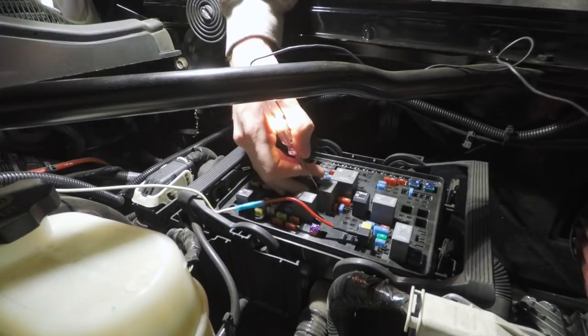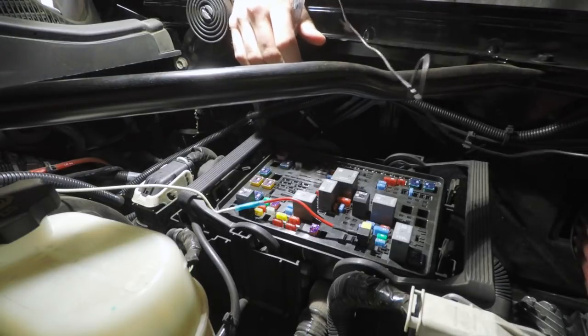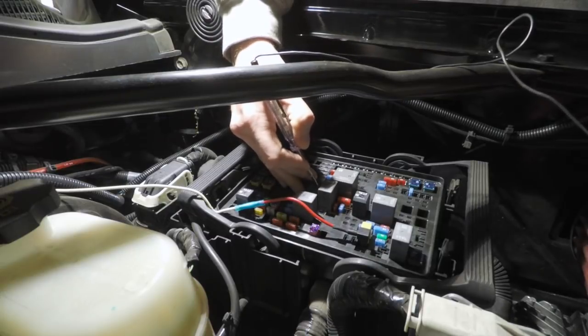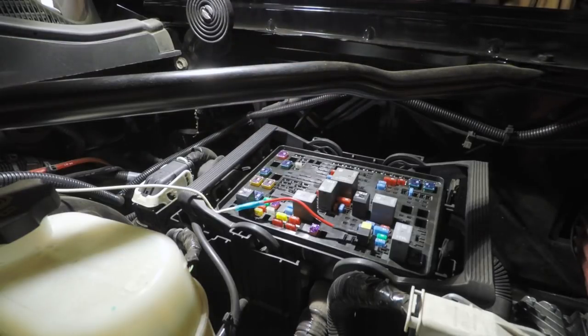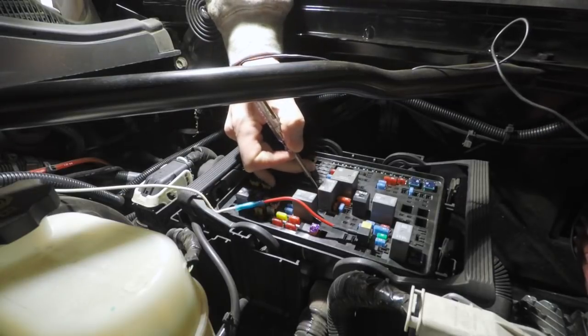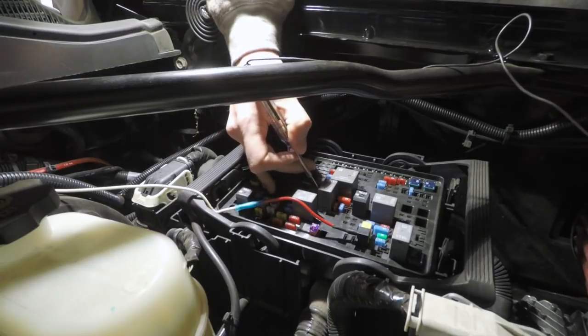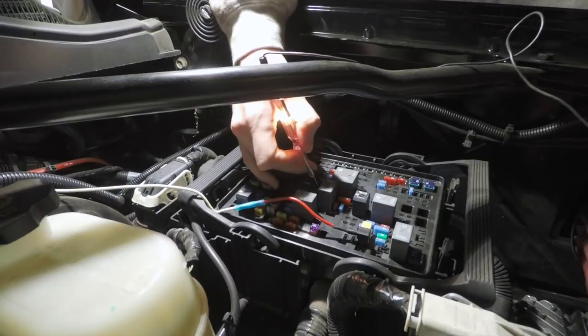So we can reference this one back to see what it is on the fuse map. And that is actually the AC climate control. And the reason it's on is because I just opened the door. This will actually shut off. Yep, there, it turned off. So if I were to open the door back up, that would come back on. So now that I've opened the door, well, I said that, maybe it won't. Oh, yeah, I'm not getting a good ground is why, but there we go.